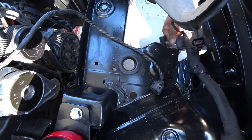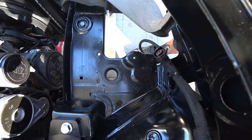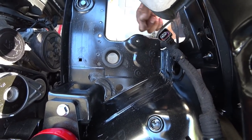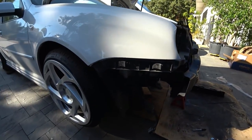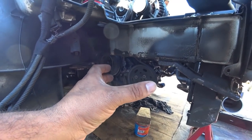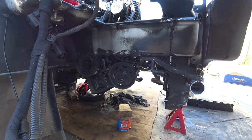Making the bracket and everything is where it's going to be a little more difficult, but not too difficult — just depending on what you have handy. I got a bunch of junk in my house so I can make something with it. I'm going to be using one of these mounting holes here so I can make the bracket and bolt the power steering reservoir underneath. We're going to be mounting it right here, kind of out of the way so nothing touches it. And then run the power steering line over there to the return line for the pump.